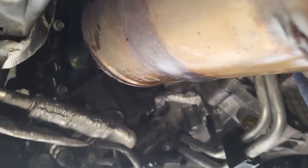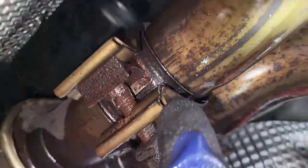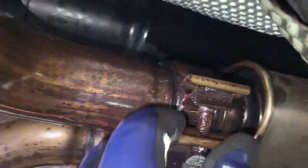While you're down there, spray WD-40 on the exhaust bolts to make opening them easier, because the exhaust is connected to the engine from the lower side and has to come out. You may decide to disconnect from the back of the exhaust, but I'm going to take out the whole exhaust to give myself enough space.